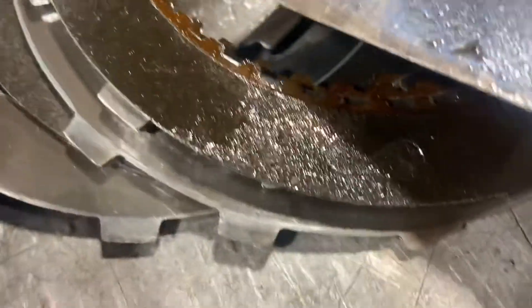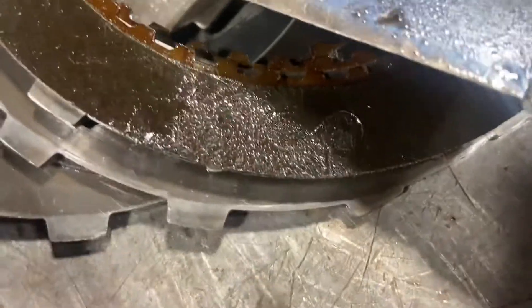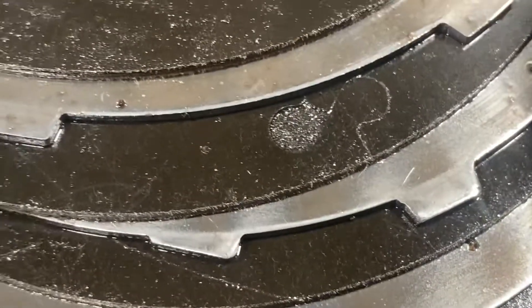Here's what we saw on the pan. Here's the top of the valve body — fluid that was in it was pretty dark. You can see the clutch components are starting to delaminate, come apart here. You can see clutches are popping apart right there as well.